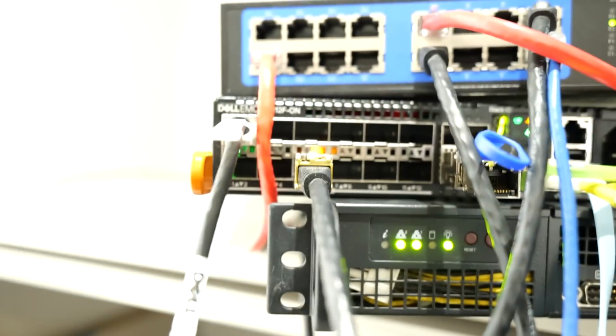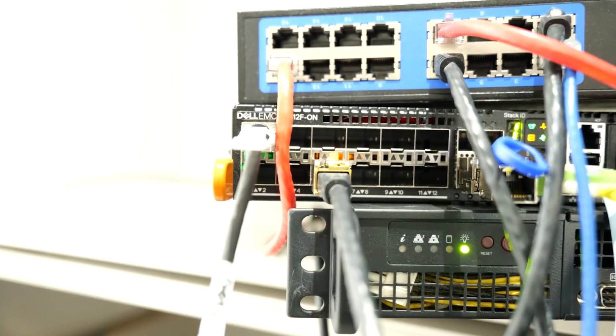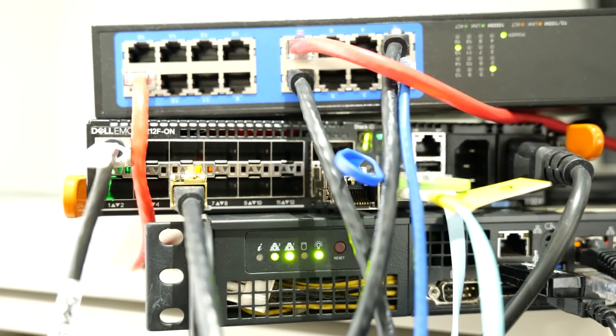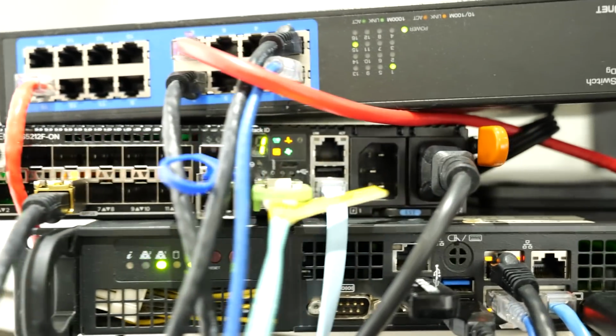The switch actually runs Debian as a control operating system. That's a whole other set of conversations that I want to get into, because on the networking side, we have the Open Network Install Environment stuff, and out of the box, the Dell switch doesn't come with anything installed in the operating system. It actually has UEFI, and you can configure stuff, and there's a forum thread on that. I gotta get my hands on some cheap ONIE equipment and talk about open switching stuff. But this is a Dell product for the switch side of it, and that's what we're going to be using for our connection for this kind of thing.